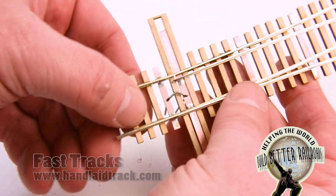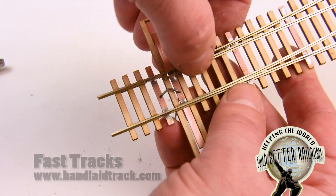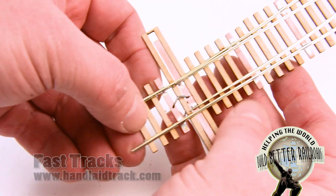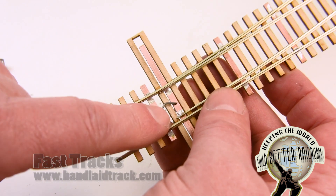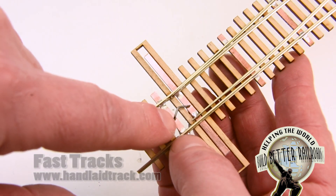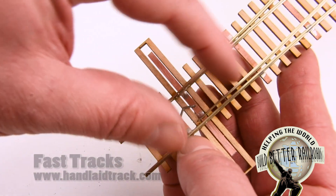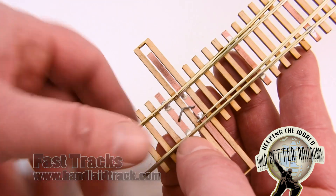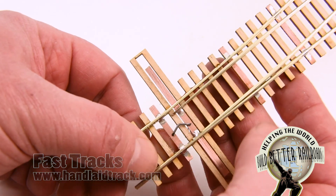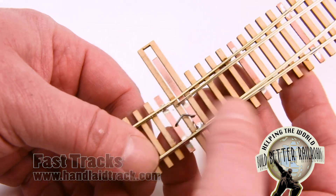Click click — that is holding very solid on there. You're not going to have any problem with this being open a little bit where a wheel can get into it. Same with the other direction — that's holding that nice and snug in there. If you're finding that when you put it in it doesn't hold, you want to open this angle up just slightly. What you want is a bit of pressure between the back of one wire and the back of the other, pushing away from each other onto the ties — that will cause the spring action. If you don't have enough of that it won't lock; it'll just move left and right. But when you get just a slight bit of tension on there, it'll lock in there nice and easily.